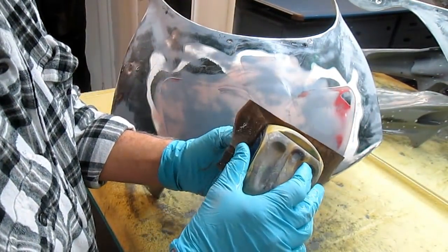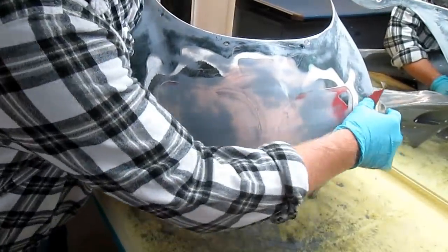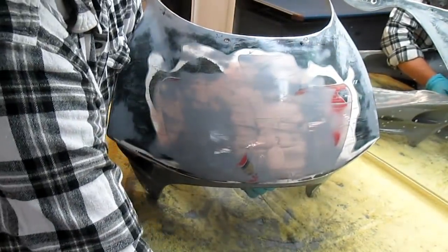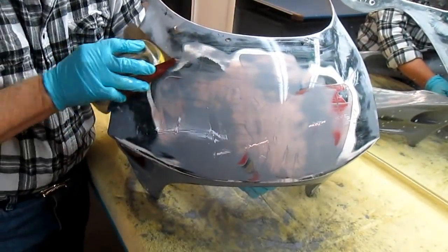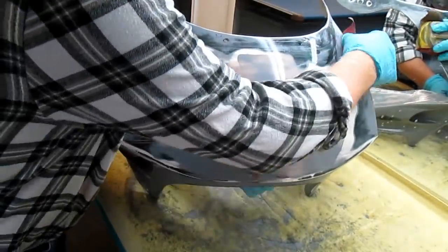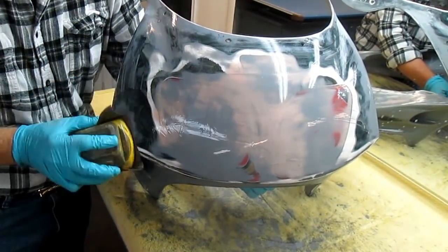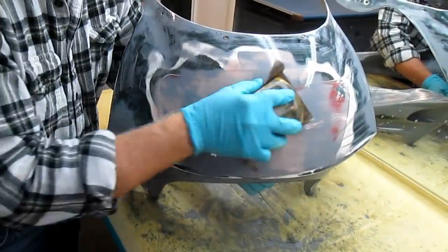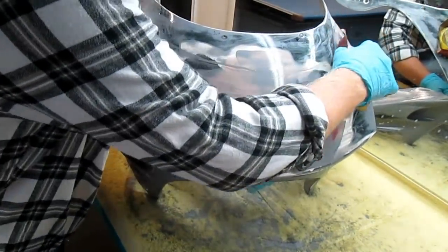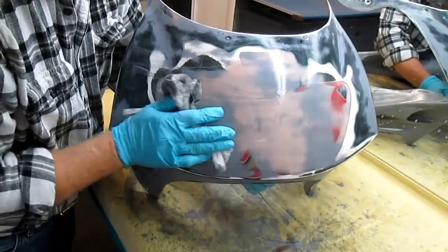Because of the way this curve is in the front, I want to take a piece of sandpaper with the block to see if I have any high spots. This is one of the final steps. When I had this mounted on the motorcycle, I could look in the side and see some of the areas that are rough - I want to sand those down once I get the outside dressed off. I want at least a smooth finish in there, because ultimately we're going to paint it all flat black anyway. All of these old parts can be reused as long as you're willing to do a little sanding, a little fiberglassing, and whatever.